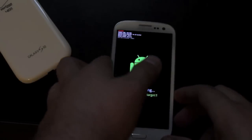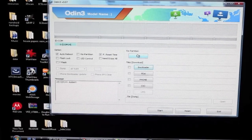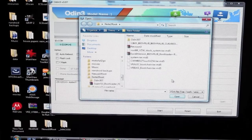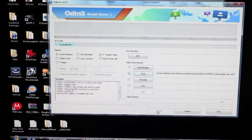Pull the battery and boot back into Odin mode — volume down, home, and power — then volume up, plug it in, and go back to Odin. This last step is optional, but if you want to be completely stock Jelly Bean you need to do it. Go to PDA, and this time we're flashing the VRBLK3 boot chain. Click Start.